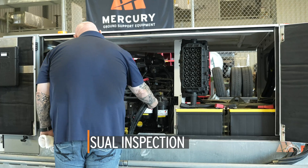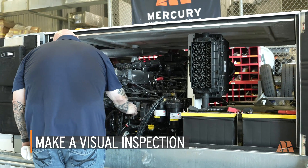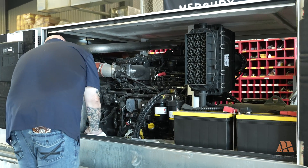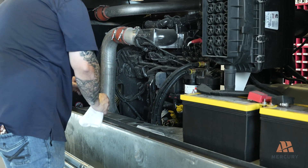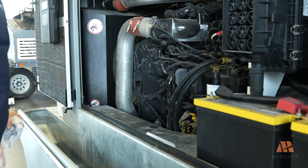Finally, make a visual inspection for any conditions that could affect serviceability, such as loose hoses or a frayed engine drive belt. Address any issues immediately to prevent operational failures.